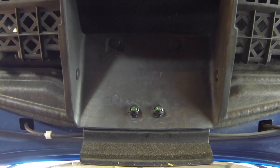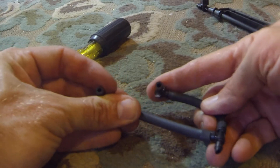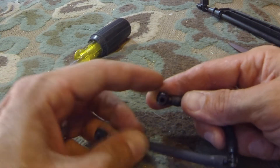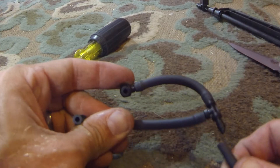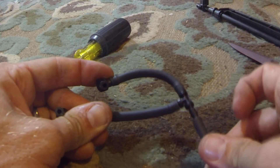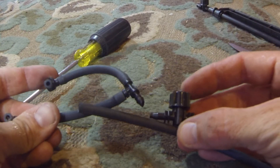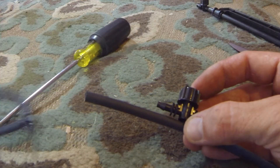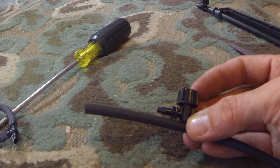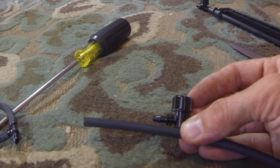We're going to plumb up the back side real quick. I'm hoping I can just put them in there like this and run the hose back out going to that other valve. Also in-line I'm going to put this little shut-off valve so I can disconnect the intercooler misters if I want to — like during winter there's really no point in running these because you get the effect just from the rain and it's going to be cold anyway.